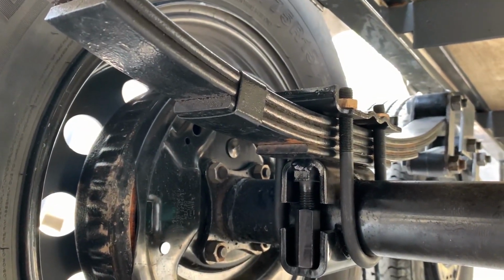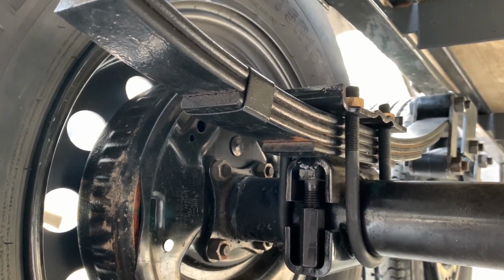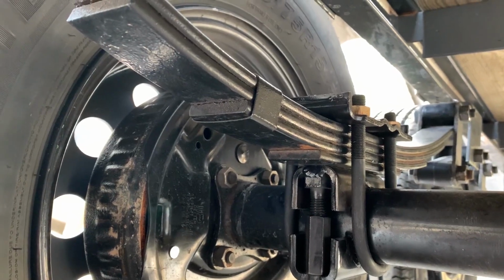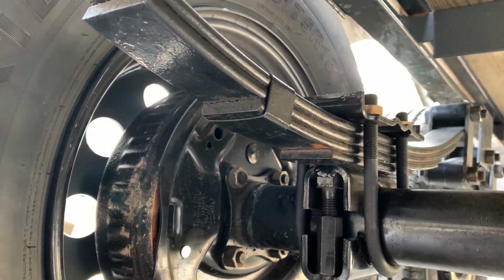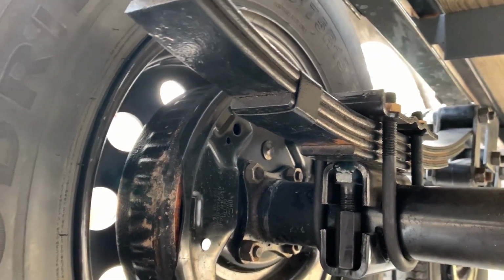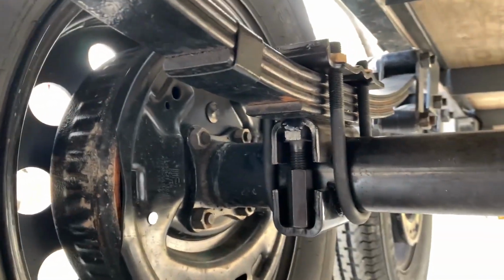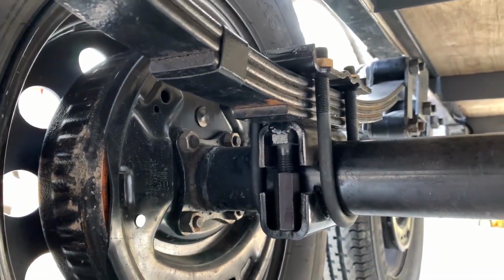And guys, if you're towing, make sure to check your lug nut torques. Just grab a torque wrench, go out and pop them. Spend 3 minutes, and it could save you from having some problems out there. And I'll just check everything else. So just do your diligence when you're towing. But I wanted to update you on this too. Everything's holding up well, and I like it.